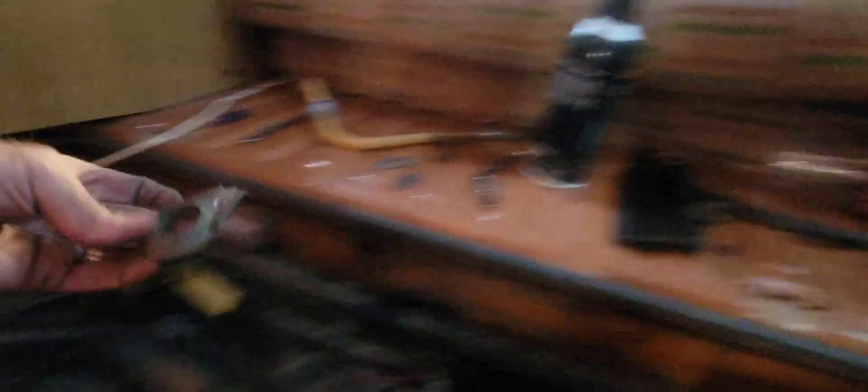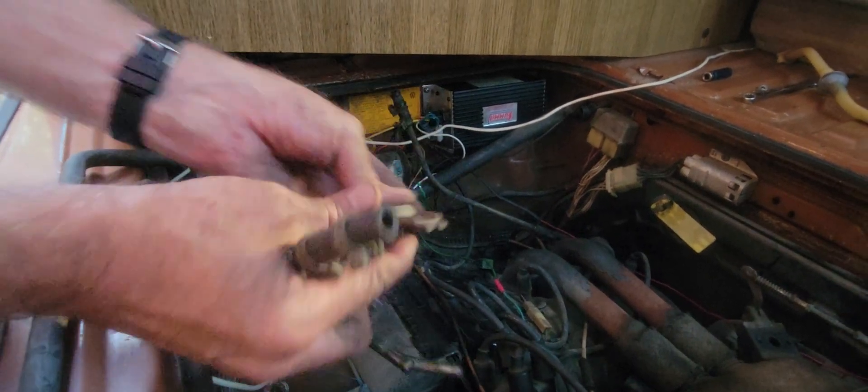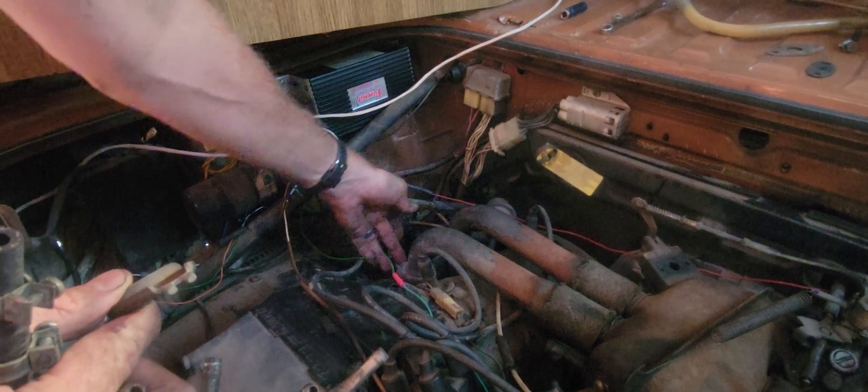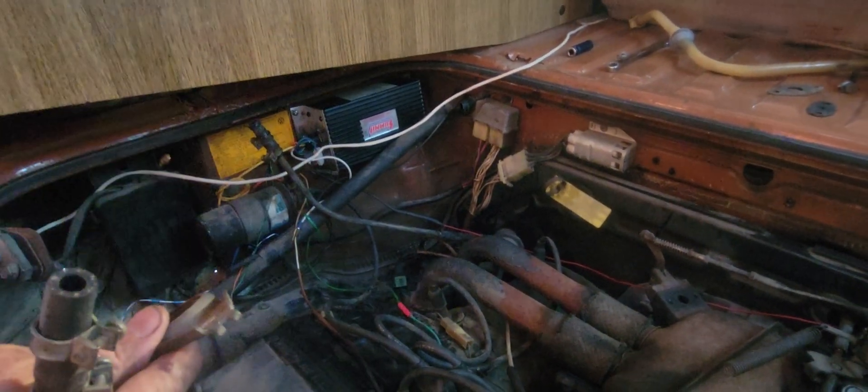On the earlier ones, when you take the injectors off, there are these little cap things on the end that are screwed on — this tooth grabs straight above here, there are two of them, and there's a nut on there. So bust the nut loose and screw it off. There's a washer and then this will come off with the injector.